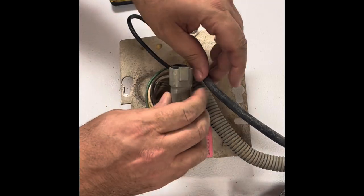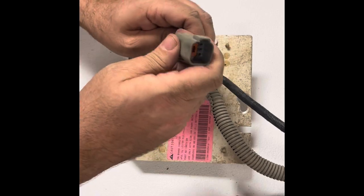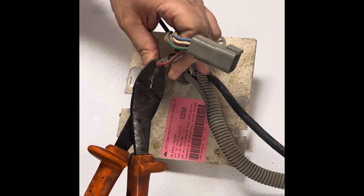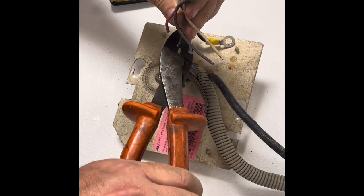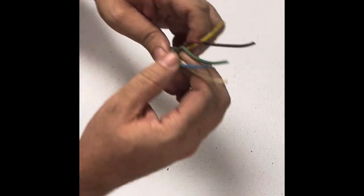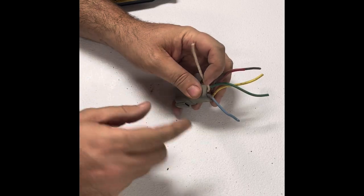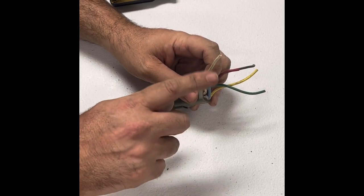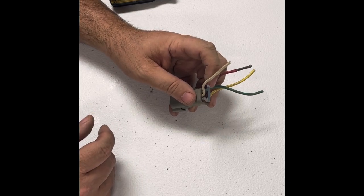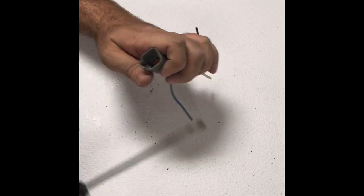This 6-pin connector in the back of the OBC was plugged into the vehicle wire harness. This computer is trashed and we're not going to use it, so there's no sense in trying to save it or reuse this OBC in the future. We're going to cut this plug off completely. Now we're left with this plug. On the back of this plug you'll see this cluster of wires. This white wire is where power comes in to the OBC from the wire harness on the car, and it exits the OBC through this blue wire and goes back to the controller.